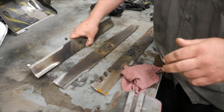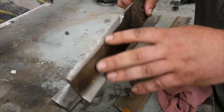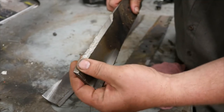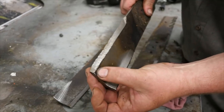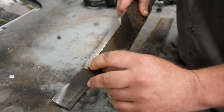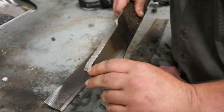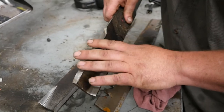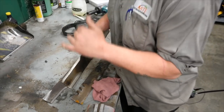Another thing is if your blade is damaged — these are little nicks off a bent set. If the end is completely rounded, you're going to be taking off so much material that you'll actually end up cutting way back to get yourself a straight blade, and what's going to happen is you'll end up with striping or your quality of cuts is going to go way down.